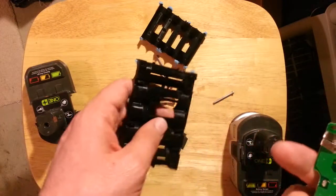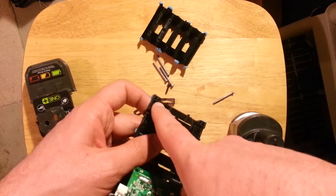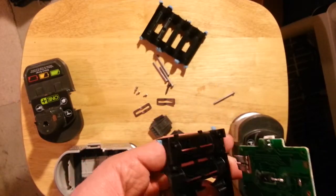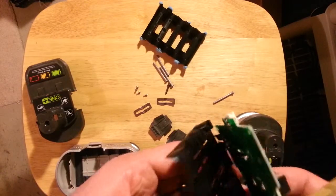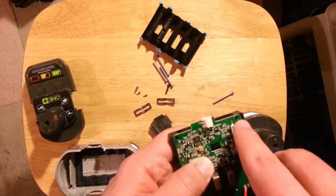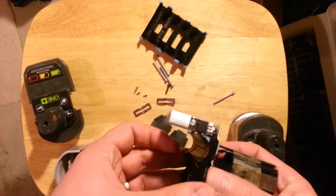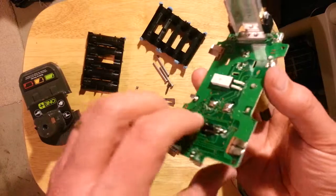This collection of small screws attaches to the top plate that sits on the battery pack, and it does so through the PCB. I've got metal everywhere so it's probably not going to sit clean anymore. The screws go through the outside corners, and then you can separate the battery pack from the printed circuit board with all the charging and voltage regulation.